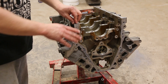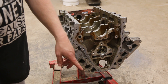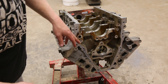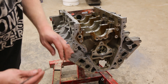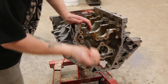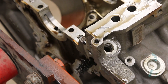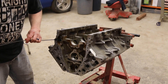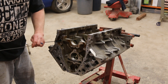Now we've got to scrub all of this out. We're going to use some bottle brushes and I like to use diesel because it breaks all of the stuff down inside. I don't have hot water at my shop so I use diesel and then we'll pressure wash this. We've got to get all of these galleys — this is your main galley. Go all the way through front to back, make sure you get all the way through the block. Dip it in the diesel a few times, go back and forth, and make sure it's clean.